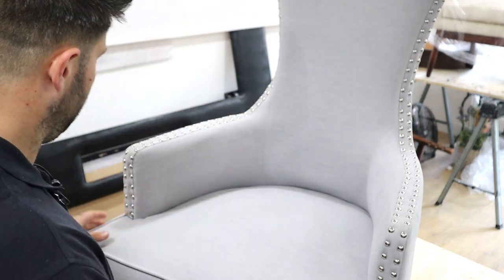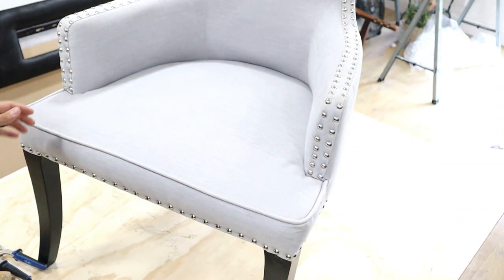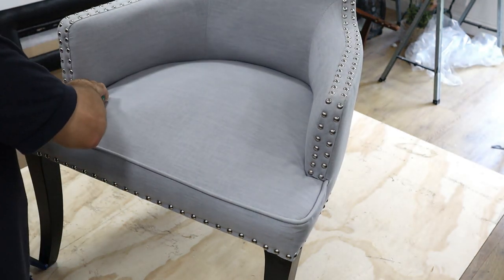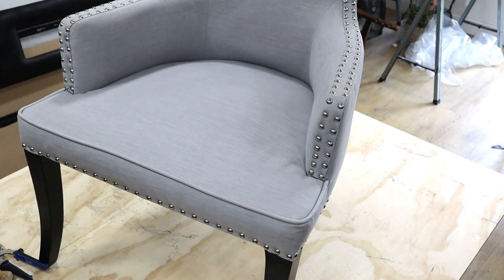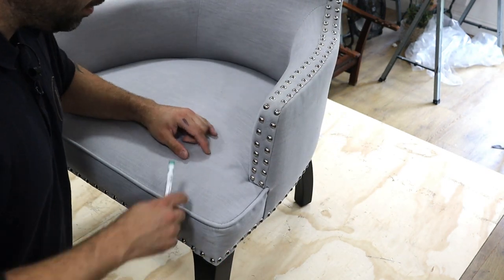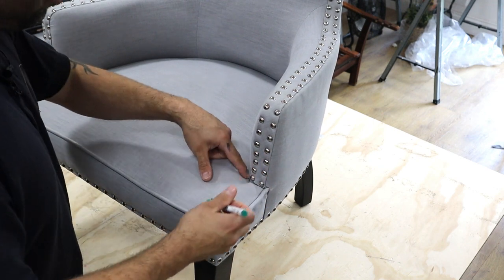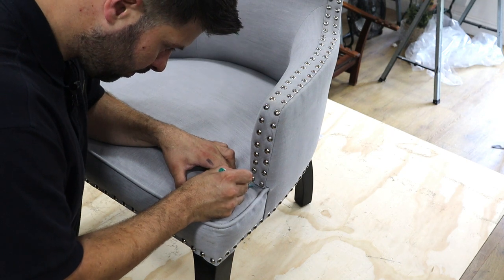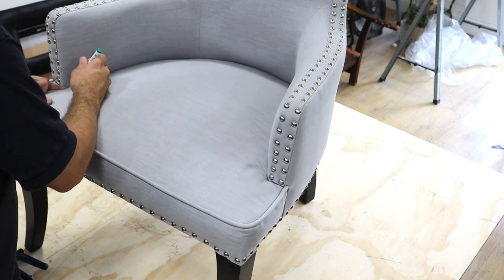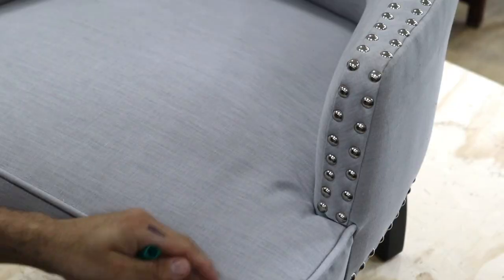What I might also do here — you'll notice they haven't collared around this corner, which is pretty important. We normally put a collar around corners like this: you sew a bit of fabric on, because otherwise you get what's happened here — the fabric is just pushed in and it's all baggy. There's no collar. So I'm going to mark for a collar on both sides, going around the corner and under, essentially. Hopefully you can see what I've marked there with that pen.